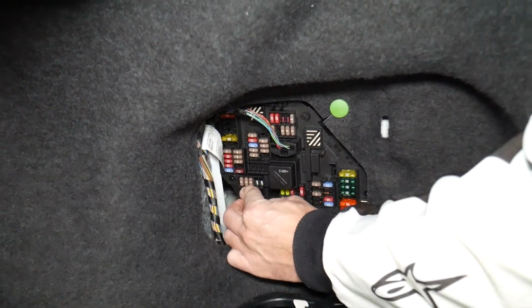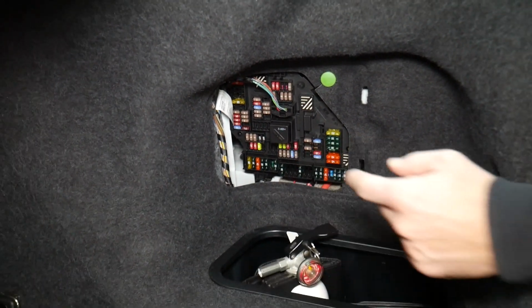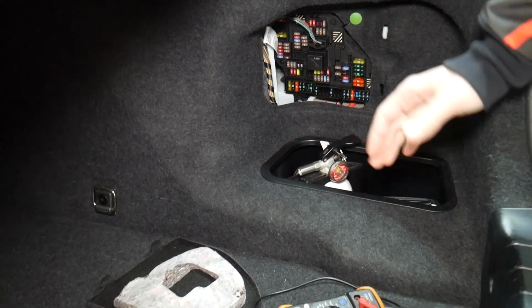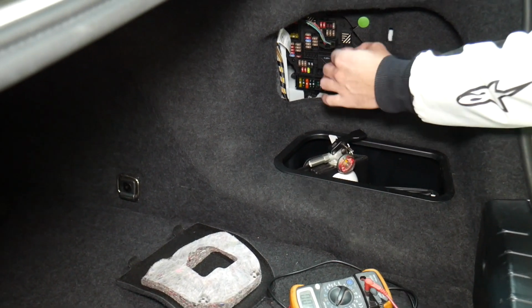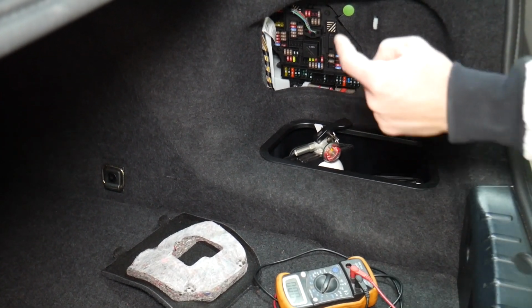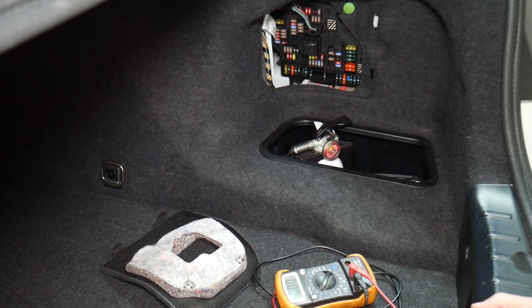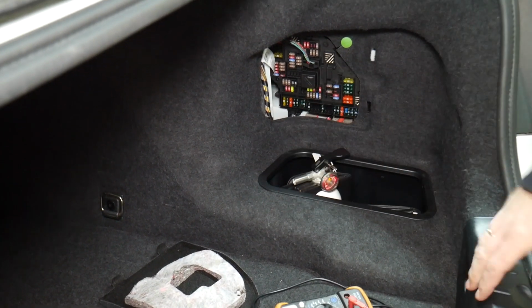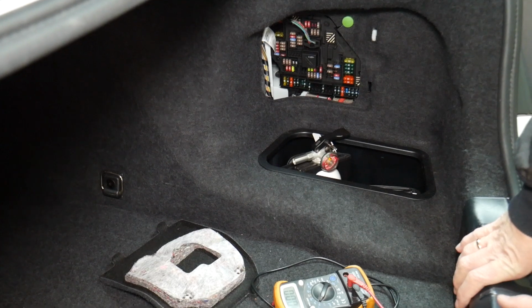Another thing, always test your relays. They're a little bit harder to test, but if you want to see how to test fuse relays, we will put a link in the description of the video below. But we've seen so many customers that think that they have a good fuse, they put it back in, they waste their money on parts and diagnostics that they practically do not need. So check out the link in the description of the video below on how to test the fuse and how to test the relay as well.